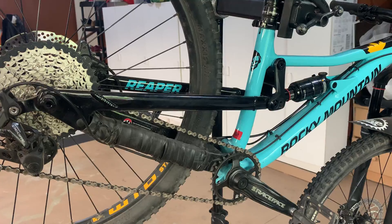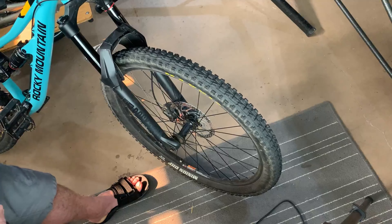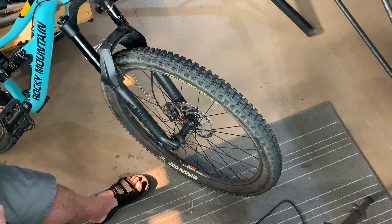Another thing to mention: these 26-inch Maxxis Minions appear to be an OEM Minion. The specified width is 2.35 inches, but it doesn't seem to match up — they look actually a little narrower. When I put my tape measure on and eyeball it, it looks maybe 2.25 inches. Not necessarily a detriment — they're probably faster rolling and cut a little better for kids when they're riding. Just so you know, they don't appear to be a true 2.3 or 2.4-inch tire.